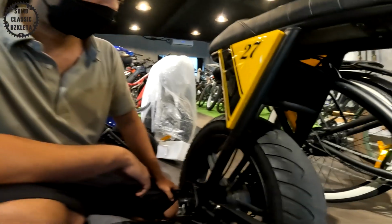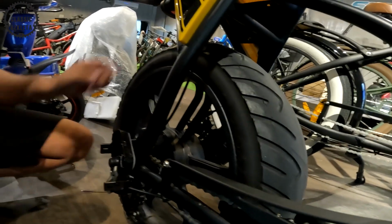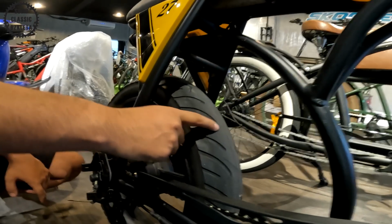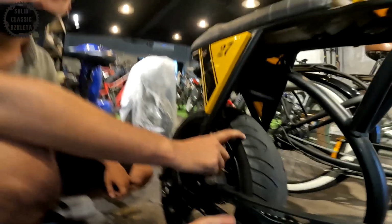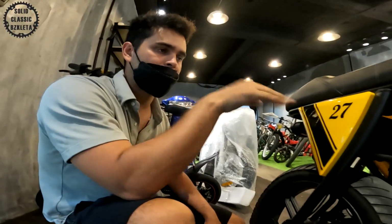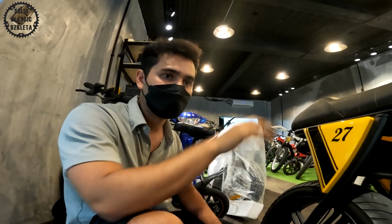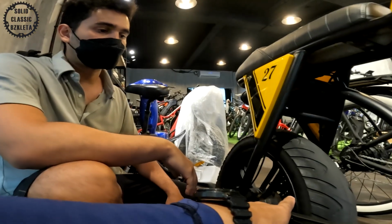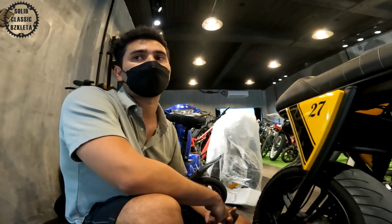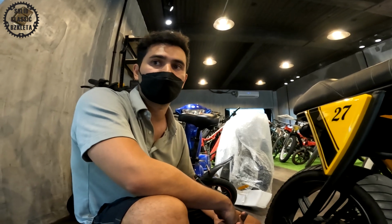Okay. Tapos ito, 7-speed, Altus, mags type, size 20. 20 by 4. Wow. I will use Innova tires. So these are typical street tires for the 20 by 4. They're very motorcycle-like because they have very nice roll. So even if the road is just slightly slanted, minimal effort, even if the motor would be off, it just naturally glides. So much better to improve the range and performance, especially for city driving. Tubeless? With tube. All electric bikes will always come with a tube. It's very unusual for it to be tubeless. It's usually done by the owner.